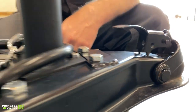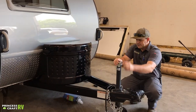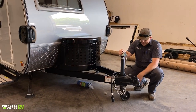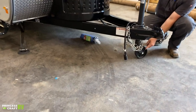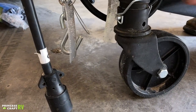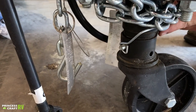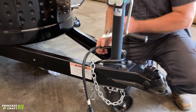We're going to use your manual crank tongue jack here to run the tongue of the trailer up and down — it's just a simple cranking up and down. When you get ready to tow, make sure your wheel is removed for travel or it will probably not be there when you get there. To remove it, all you've got to do is pull this pin right here and pull the wheel off.